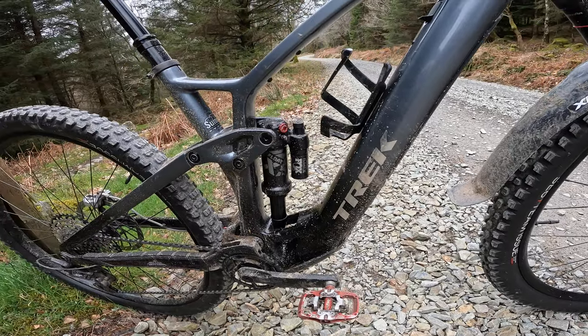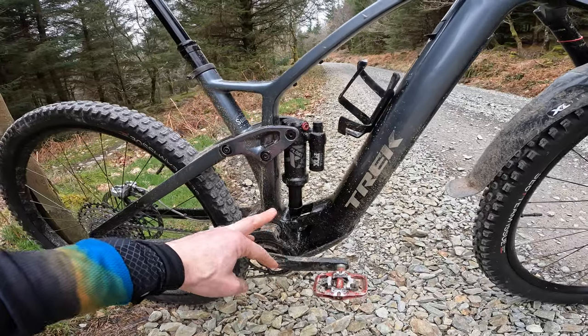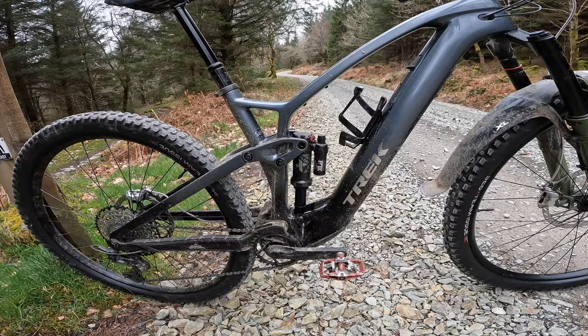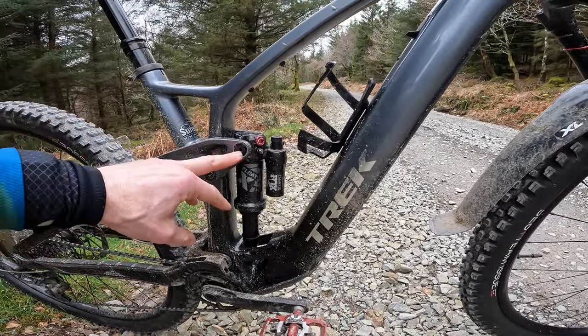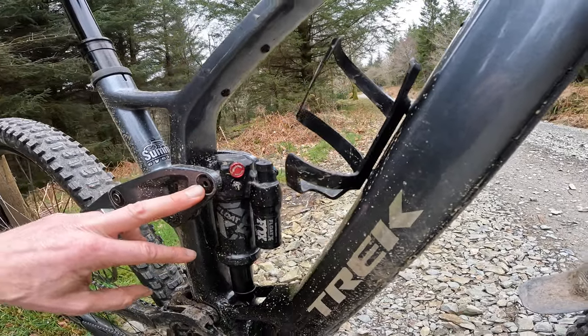And I think it obviously speaks to the bike as a whole that it's a piggyback shock on here. It's a 60mm long stroke on a 205mm long shock. So you're getting a lot of suspension stroke in there, relatively low leverage, and it's a trunnion mount as well, which keeps the whole setup super sensitive at the top.